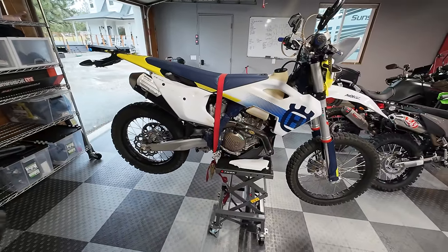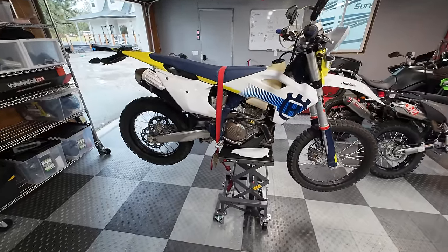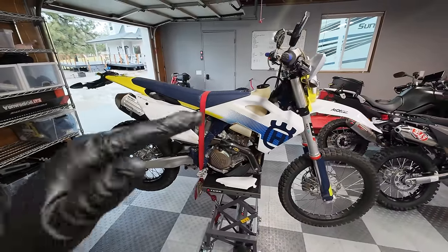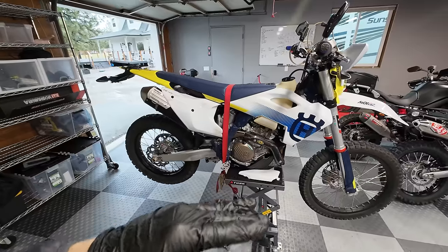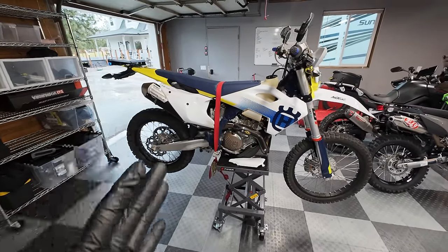So unless you're a 150 pound rider with 20 or 30 pounds of gear at most, you're overwhelming the factory springs. This changes the riding dynamic of the bike because you have the back sagging down too much, you have the suspension too far compressed into its stroke, and you just don't have the right setup for your weight. So again, that's what we're gonna do.